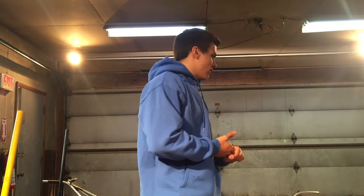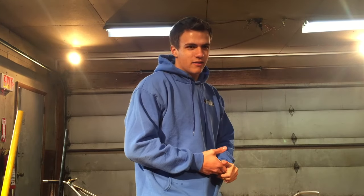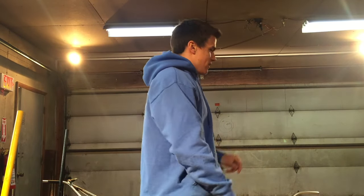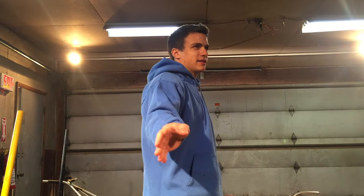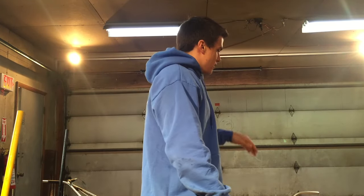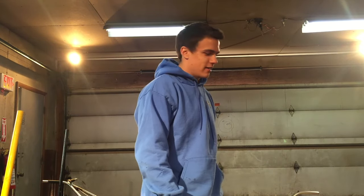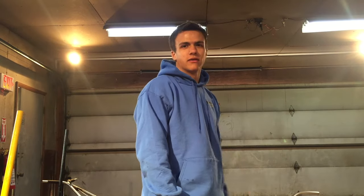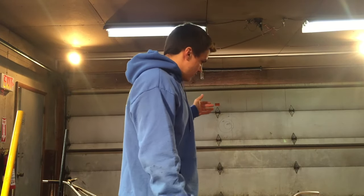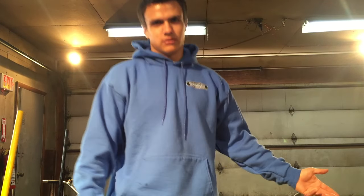All right, so you put on the primer, then your main coat, then your clear coat, then you let it dry for a day, or 24 hours. Come back, wet sand it with like a 1500 grit sandpaper. Then you take a cutting compound and you buff it, and that way you get no orange peel or anything like that. So right now, I'm gonna get ready to start washing this. Actually, I've already kind of started, so come with me here.